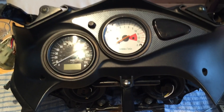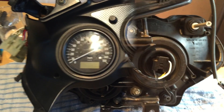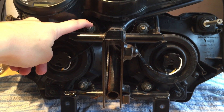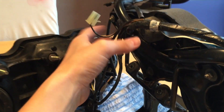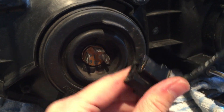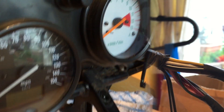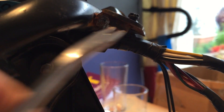Taking the front dashboard off — there are two bolts and a hex bolt, and then the plastic panel will lift off. Next we're going to do the headlights with four nuts. There's quite a bit of wiring on the back, but it turns out the headlights are just three pins, so I'm going to clean up these contacts while I'm at it. Mine were quite corroded so quite difficult to pull off. I'll pull these off, give it a nice clean, and then take all the front dials off after. The wires attach to the frame — just gets underneath that plastic bit and pulls them all through.